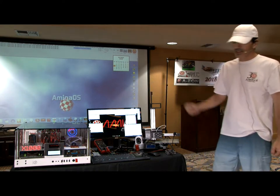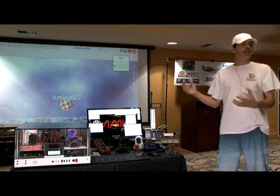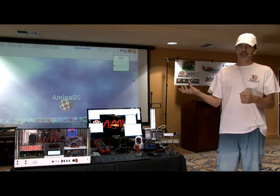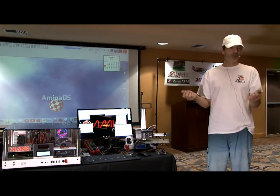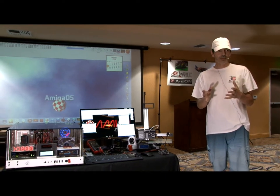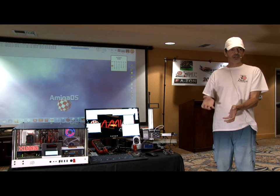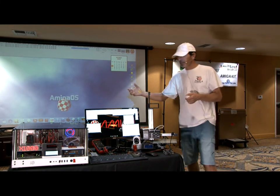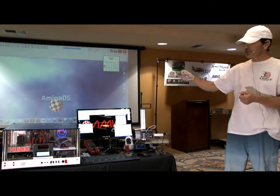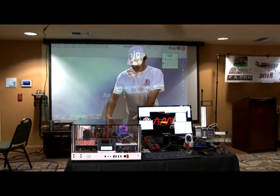First I'd like to cover the cooling system, because that took me so much work. Where I live there's a lot of dust — it's so dusty that every two weeks I have to clean the inside of the computer or the heat sink gets completely clogged. I got so tired of it that I decided to go with Peltier cooling elements, because they basically pull the heat from the inside, go through the module, and release heat on the outside. So as long as you blow the heat out from the back, it basically stays cold inside. That's why I made that custom case.